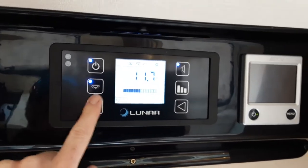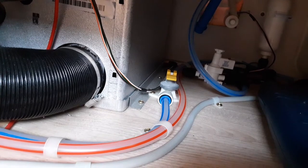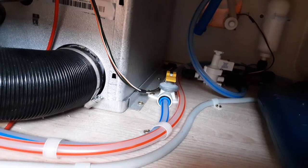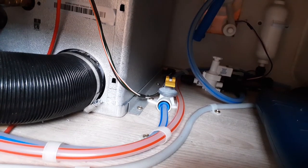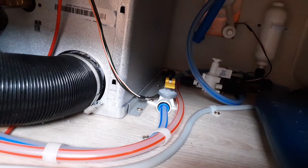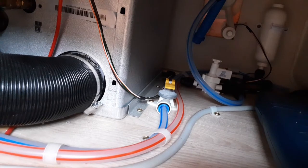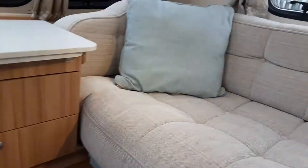You've got your water pump control on the bottom left-hand side of the screen. To fill the water system, down in this cupboard on the right-hand side, underneath the front right-hand seating area, you will see a yellow valve. That yellow valve is the drain-down valve for the caravan, so it will need to be parallel with the floor before you fill the water system up. If that valve is upright and pointing towards the bottom of the seat, all the water you try putting into the caravan will actually drain straight back out of the system. We advise after each use that you completely drain the system down. The valve needs to be parallel with the floor prior to filling the water system up.